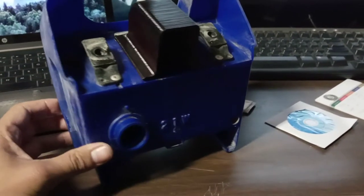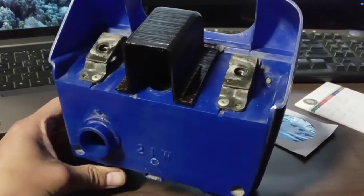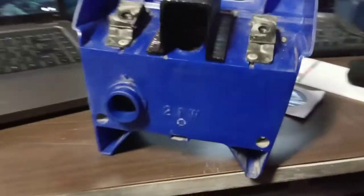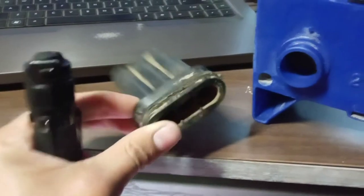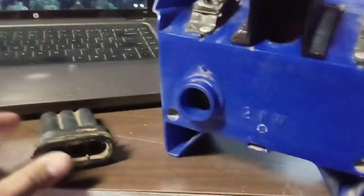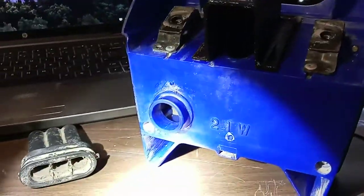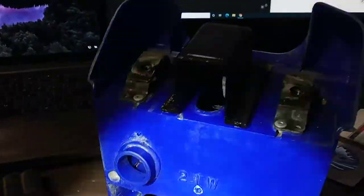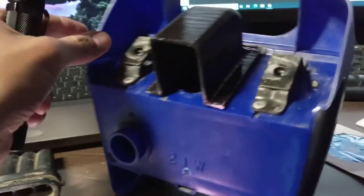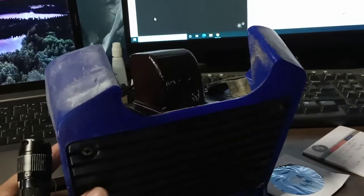This is a 3D printed guard for the PW80 that I bought. It has this snorkel stock that goes right there, and they say if you remove it you get a lot more airflow and a little bit more power, but you need to cover that hole from all the dirt that the front wheel is gonna be slinging up towards it.